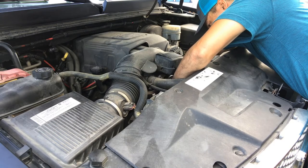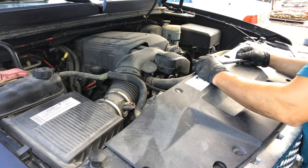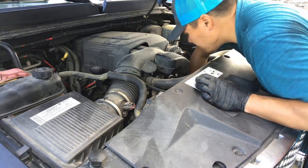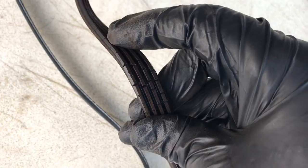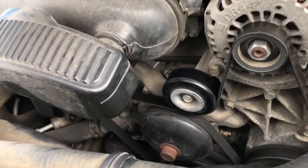I like to slide it off the water pump first. With the main belt loosened and out of the way, you get to the lower tensioner on the AC belt — all you need is a 3/8 drive. Here's the old belt — this is what I was talking about. Your belt has cracks in it; that's definitely well past the life of your belt. Alright guys, belt's on — pretty straightforward job.